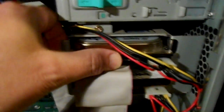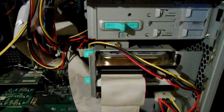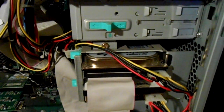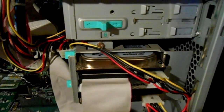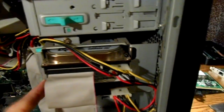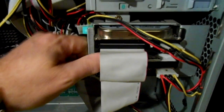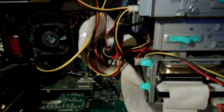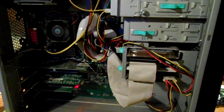Again, back to the hard drives, just IDE hard drives because it is an older machine. The first hard drive is smaller, it just contains the operating system, which is Windows XP Third Edition, plus the DVR software that came with the card. The second drive is actually your data drive, and it's formatted and used in a proprietary way that makes the DVR work. I've got, I think, a 40 gig in there, and I use motion recording, which means that the cameras are recording when motion's detected, and so I can get about one week out of it with normal use.